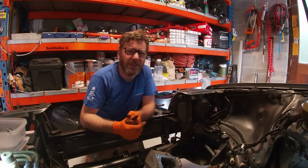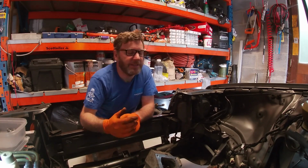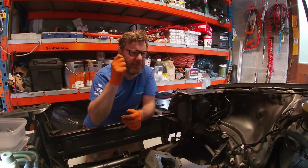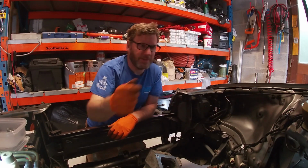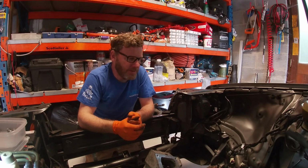Did I mention that? Oh, sorry, I probably didn't mention that in the initial review. Yeah, I've also done the pedal in place. So that's in there. I then fed wires down there and up here, and thinking afterwards where the VCU is going to go, I was like, no, it's going to go down there, so I don't need cables going up and down. I can just feed them across inside into that control unit, down the passenger footwell, and we're away. So there's not a lot really. I don't need to take away too many of these wires. I can reuse quite a lot.